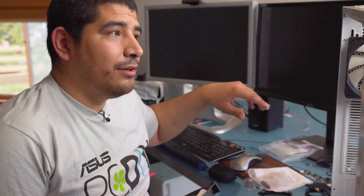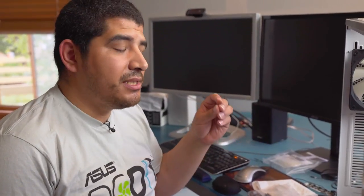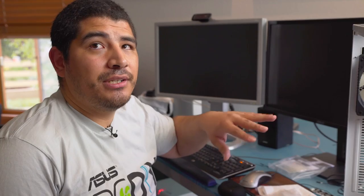Okay. So you can, let's say, put in a GTX 760, or in your era when you bought a 680, you could have bought a 660 as opposed to the 680, and you probably would have seen 90 to 95% of the same exact performance, but at a significantly lower price. Oh, yeah. Because it can't actually utilize those additional cores and shaders and technologies that the graphics card has, which are predominantly geared more towards gaming than towards content creation.